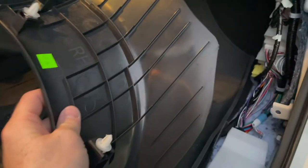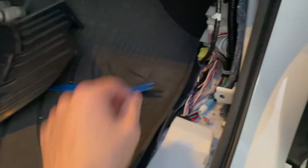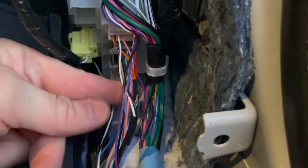This one's a little more stubborn but still not bad. I just reach my hand up under this tab, pop it off that little stud, grab and pull out toward you. I know it made a violent sound but it's fine — the clips are engaged and still good. These are easy to find on Amazon if you break one. So what do we have here — more harnesses. We want to find the speaker harness, which won't be a very big one. It's a small one.